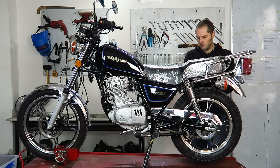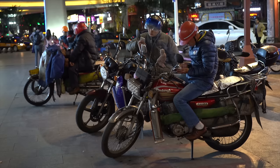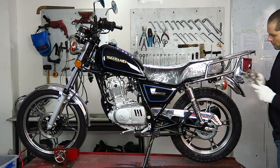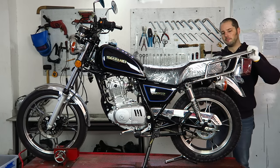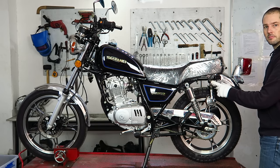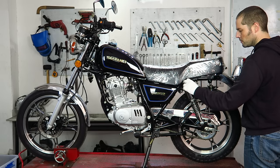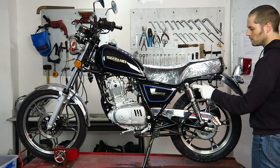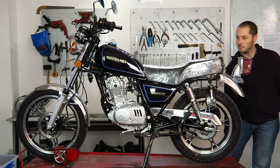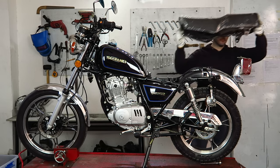So what we're going to do is start by taking off all the crap. Especially these Chinese versions — they're meant to be used as delivery bikes, taxi bikes, things like that. So there's a lot of junk on them: a big luggage rack on the rear, obviously all the very ugly lights, and a very ugly big thick seat which looks comfortable but trust me it's not. We're basically going to start by removing all of those — they just simply bolt off. Just remember where the bolts came from; put them in a bag if you need to. Once you've managed to remove the luggage rack and the horrible seat, it's time to move on to one of the biggest things that changes the look of this bike — and that is the rear fender.